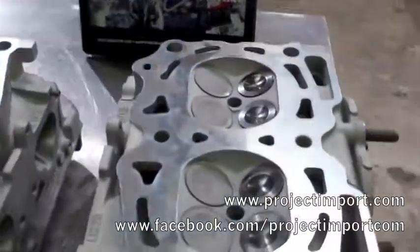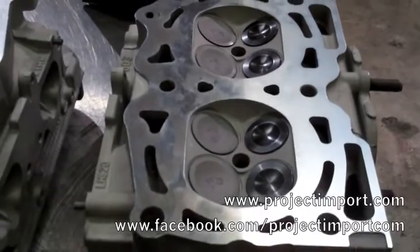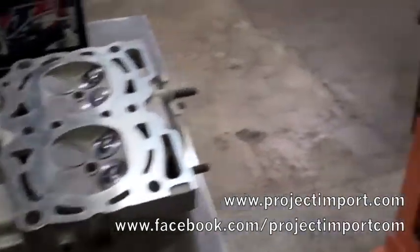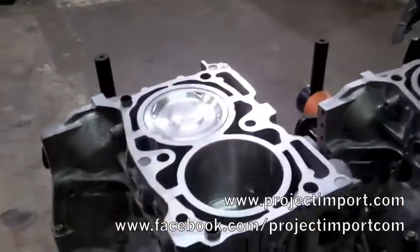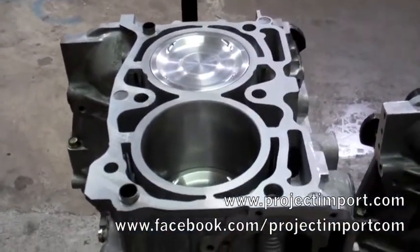The reason for that is on the WRX heads, the dish or combustion chamber in the cylinder heads is 48cc's, and STIs are about 57cc's. So JE decided to design a piston with an increased dish to keep the compression ratio the same when using 2.0 cylinder heads.